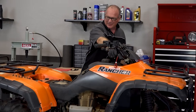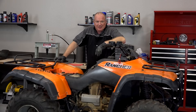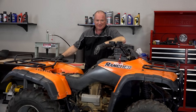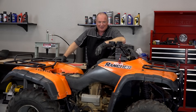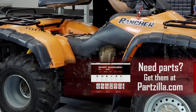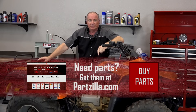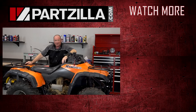That sounded a whole lot better. You'll notice when I first started it up it was idling way high — and that's because this thing has had a problem with that slow jet being stopped up. How they compensated was by bringing the idle up to where it more or less bypassed the low circuit, actually going into the high circuit to make the machine idle. Pretty much figured that was going to happen — so it's definitely good to go now. All we've got to do is get our seat back on and she's ready to hit the trail. If you need any of the parts we used, come see us at partzilla.com. If you have any questions or comments, leave them in the section below and I'll do my best to answer them. Until next time, thanks for watching.